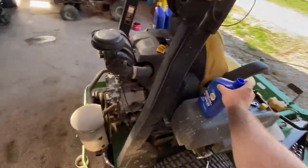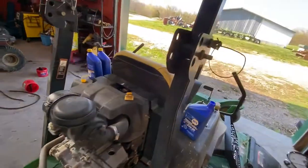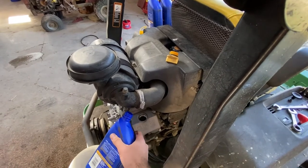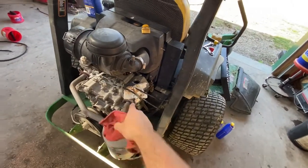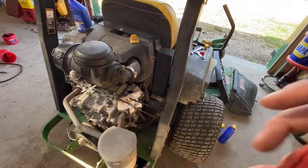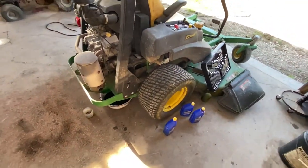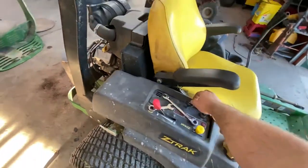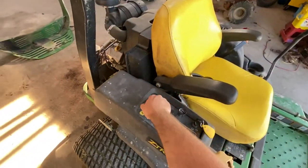The last and final step is filling up the engine with oil. Make sure your bottom drain plug is tightened up and the filter is on good. A little technique - start pouring it in sideways if you can get it going fast enough. After pouring, take the dipstick out and check it. I put probably two and a half quarts in, which may have been a little much, but remember you have the filter and all the oil galleys in the engine to fill.